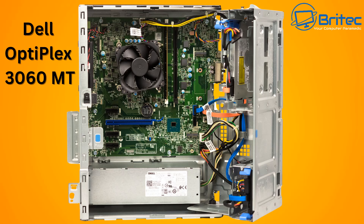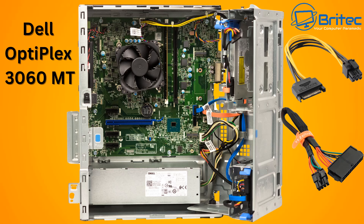You can see that thin, long, low-power power supply and a tiny 80mm fan exhaust on the back. There are only two RAM slots. You can get a graphics card in here, but it's going to be limited because of the way the chassis closes — it restricts the length of card you can put in. Also, there is no power cable from the power supply for the graphics card, so people recommend using SATA-to-PCIe adapter cables.